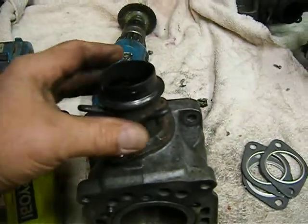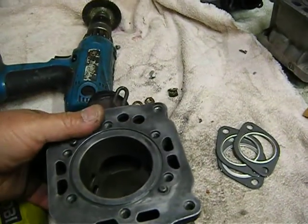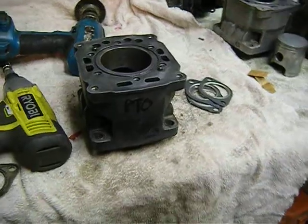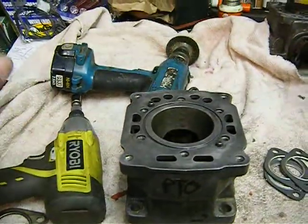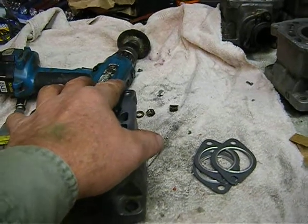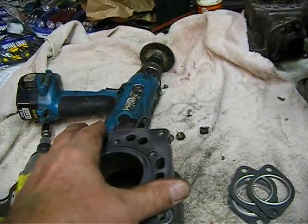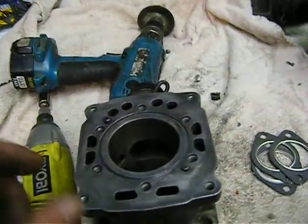Your manifolds are each slightly different depending on their position on the engine. You want to put them back on the same side so you won't have to take them off again. I marked this cylinder PTO — somebody had marked it number two, but I marked it PTO. Sitting on the sled, the clutch is here, so left is PTO, then the middle cylinder, then the mag cylinder. You want them exactly the way they came off the engine, because you can swap cylinders around but you must use the correct parts or the pipes won't fit right.